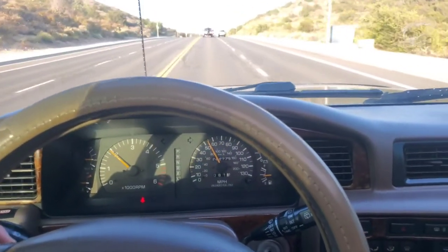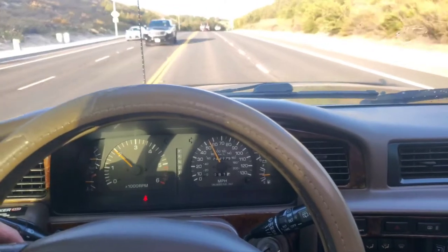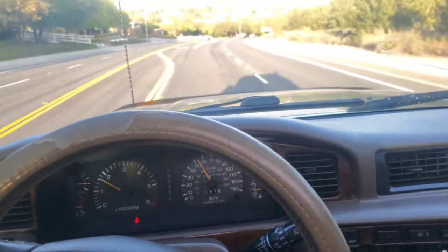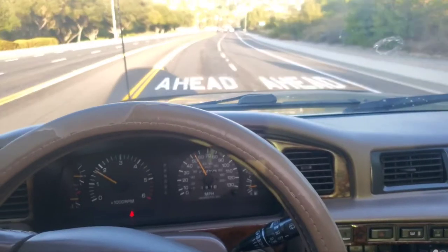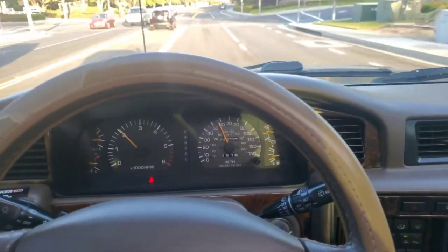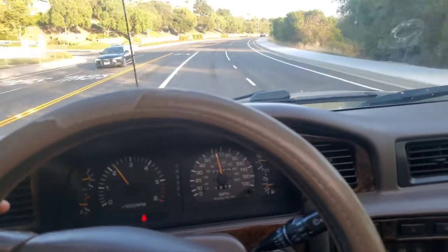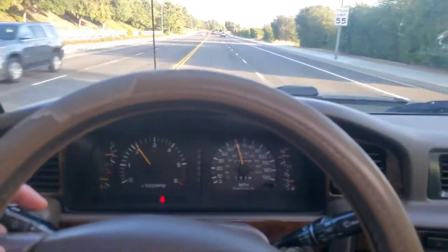Turns out the old one was just not long enough. Whoever had this truck before me didn't have a long enough drive shaft for the lift, because we're figuring this is a six inch lift, not a four inch lift — so it probably had a four inch lift double cardan drive shaft in there. Foot off the gas going downhill — no vibration whatsoever, totally smooth. Also, I removed the King shocks that were in there and put Dobinsons shocks to match the coils and springs, meant for a six inch lift.